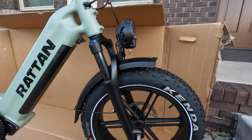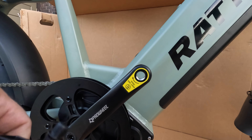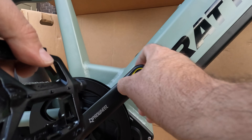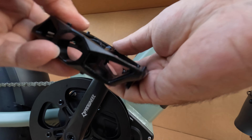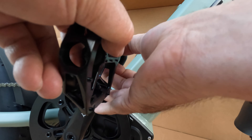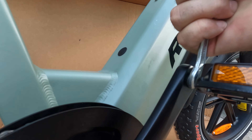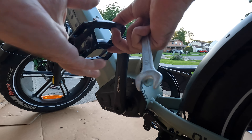Look at that baby. Let's go ahead and assemble the pedals. I'm always going to say it — there's a left and a right pedal. They're going to be labeled on the crank arm, and they're also going to be labeled on the pedal. As simple as it sounds, you don't want to put the wrong pedal on the wrong side. It even shows you the direction to turn the pedal on. Go ahead and tighten that pedal down, get it nice and snug. We'll go ahead and do the other side. Can't get easier than that.